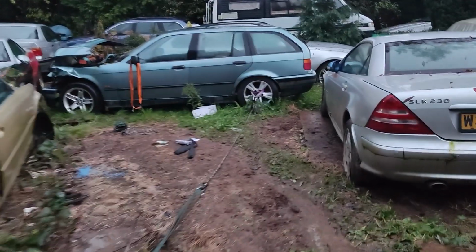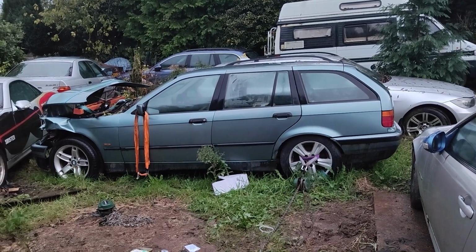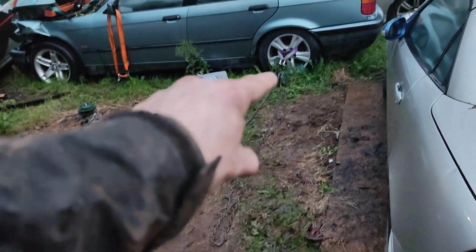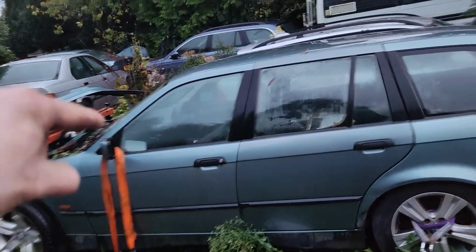So what I'm going to do, seeing as it's still raining, I'm going to call it for tonight. First thing tomorrow, we're going to come out and crack on with these. Get this pull done. Get that vehicle sorted out and round. But everything's now in place. Ground anchor. Ratchet strap. Chain hoist to the wheel. Lift sling. Pulling sling thing. Chain hoist to go to the opposite wheel. To go to that wheel there. To get it to slew round.